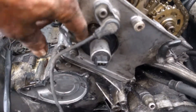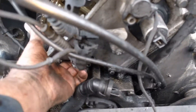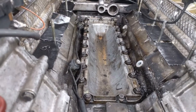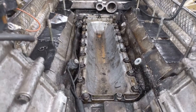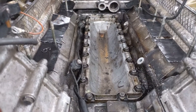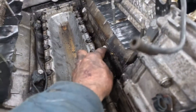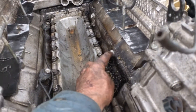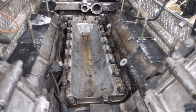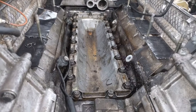I got all my covers back on, my gasket's on here. I'm going to go ahead and stick the chain tensioner in next, and then I'm going to change the valley pan cover — that's pretty straightforward. I ordered one that supposedly has a reinforced gasket instead of a plain old BMW gasket. You've got to take the knock sensors off — or you don't have to, but it's a whole lot easier. Take the knock sensors off one side to give you more room in there, then just take it out and put it back in.